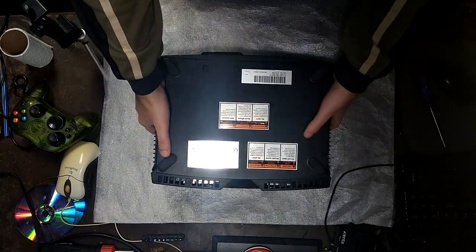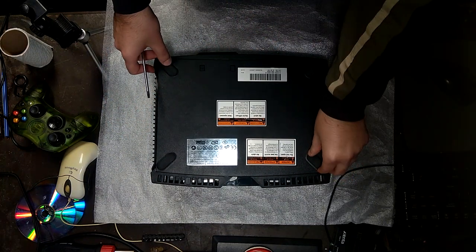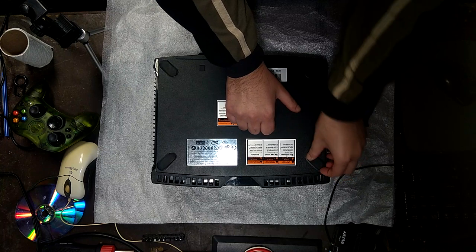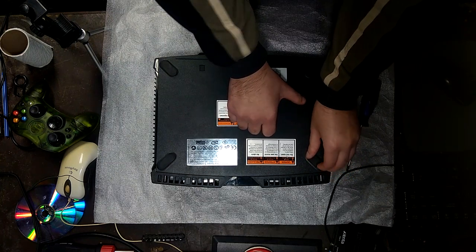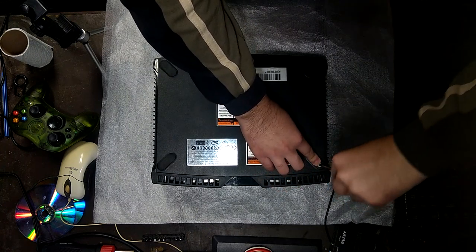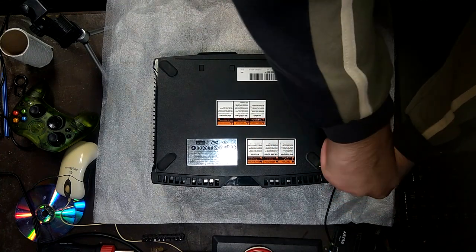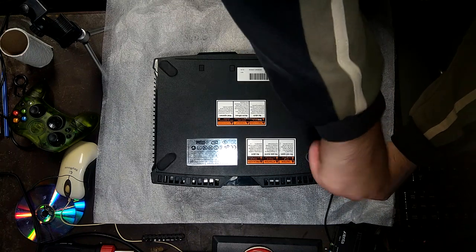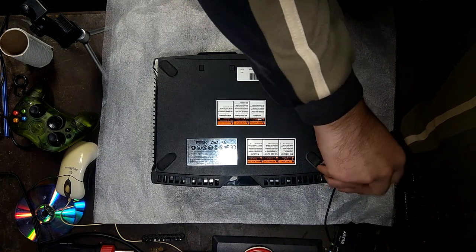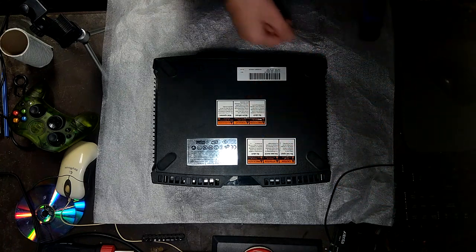So gonna start by removing the screws. There are six screws on the bottom. I believe these are T20. So you wanna just peel off the edge of the rubber feet so you don't lose them later on, because there's some adhesive, and at least the rest of the feet will be holding it in place. I'm gonna go ahead and remove all of these screws. I peel off as little as needed, so that we can still keep our feet. This is interesting.